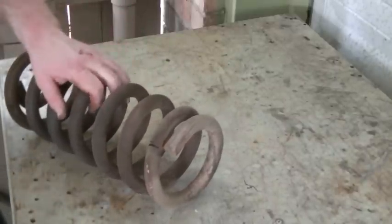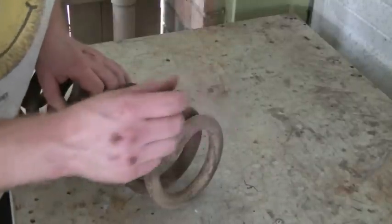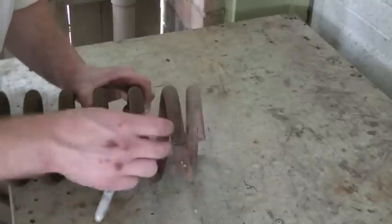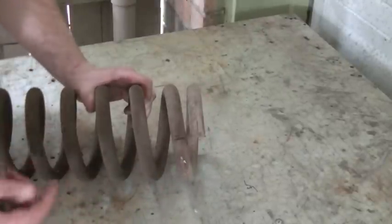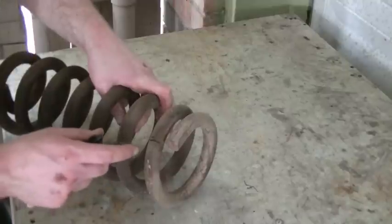Now, it's highly recommended that you set the spring, meaning you heat it up and you kind of fold it so that you have this little pigtail area right here that's kind of flatter than if you had not bent it. I'm not certain that I can do that. I don't have an oxyacetylene torch. All I have is a map gas torch. And I'm not certain that that's going to be hot enough